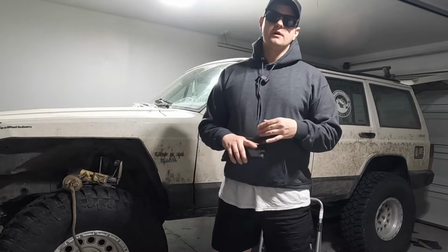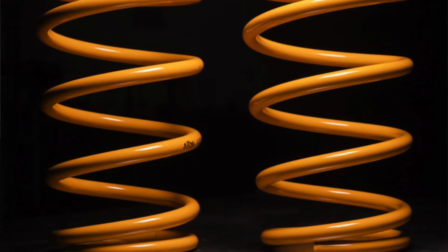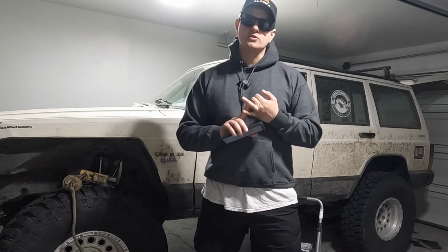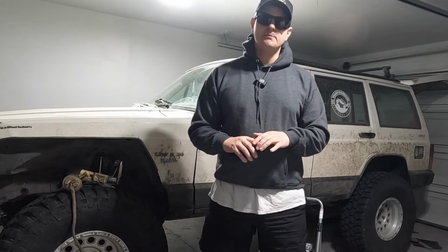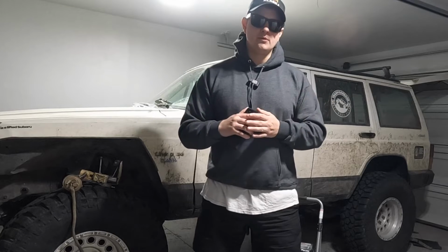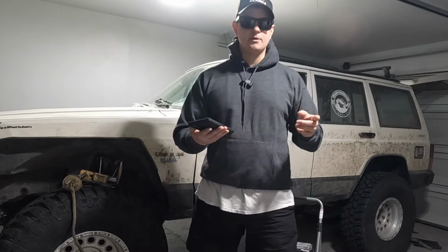Now, if you're just looking for a 1/2 inch to 1 inch lift on your car, you can actually achieve this using lift springs. And for some people, lift springs are the way to go if they're going to be carrying a lot of heavy gear, if they've got a small trailer that they're trying to tow, or anything that's going to be weighing the car down substantially. A lift spring might be the correct way to do this. Or some people just like the more sporty handling of a stiffer suspension, so this might be the way to go. They do great on the street. They're a little bit more bumpy and harsh when you leave the pavement, but it just kind of depends on your driving style and your habits. So that's the first category of sizes, between a 1/2 inch to 1 inch.